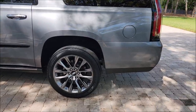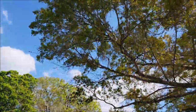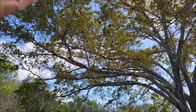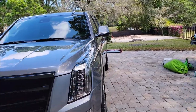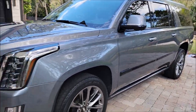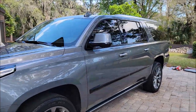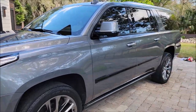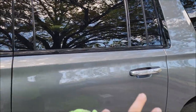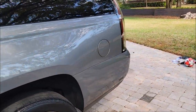All right ladies and gentlemen, this Escalade is all done. We've been fighting debris from this oak tree the whole time — every time we open the door, more pollen and crap drops off into the vehicle. What I did was I used the Gary Dean wash method, rinseless wash with Infinite Use Detail Juice. I clayed as I washed — I'd take one panel at a time, wash from top to bottom, and since the panel is clean but still lubricated, I clay and then wipe everything off. I did that all the way around the truck.